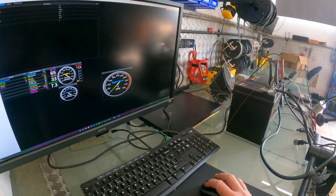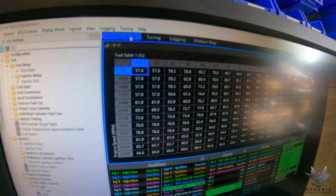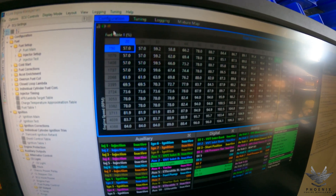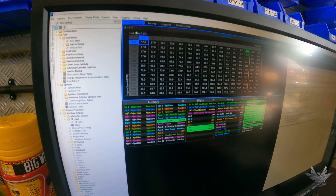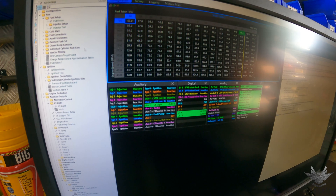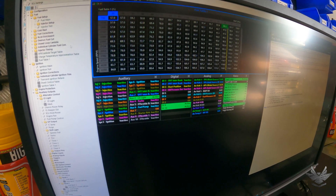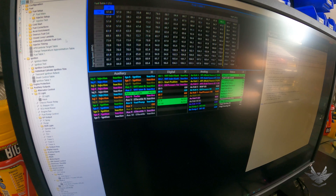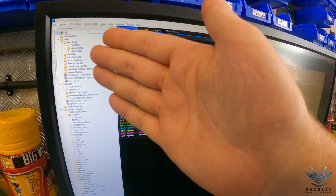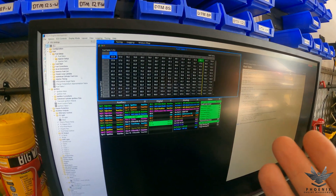In terms of the software, you're going to end up in your configuration tab because it should be part of the setup of your ECU itself. You want to go through and see what outputs you have and what you are able to test. In this particular case I'm going to be testing things like the injectors, the coils, and the oil control valves. In this setup I don't have acoustic control induction system valves, but that's another thing you could possibly test. We're going to go into the menus and test the injectors one by one — they're easy to hear on the camera.